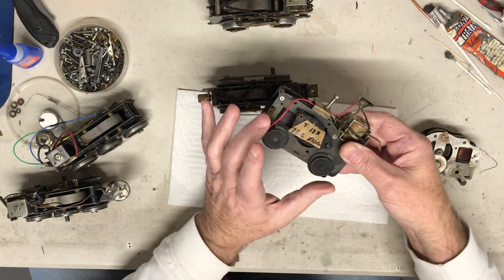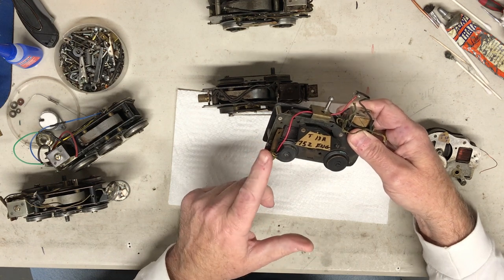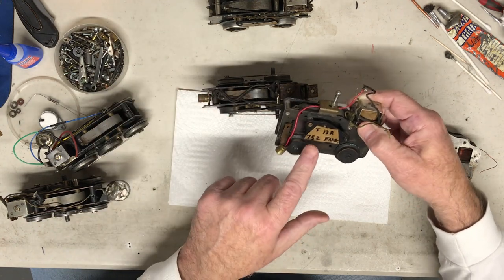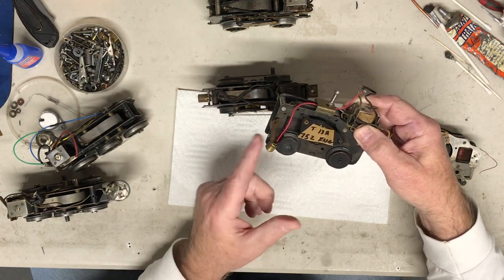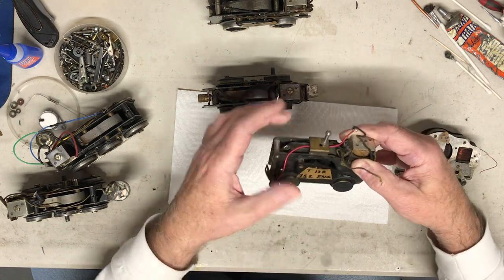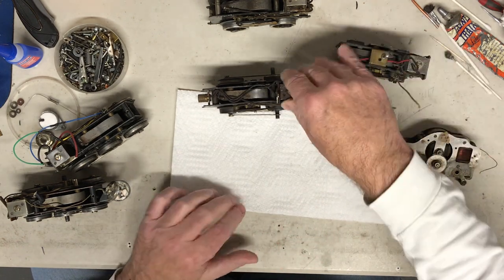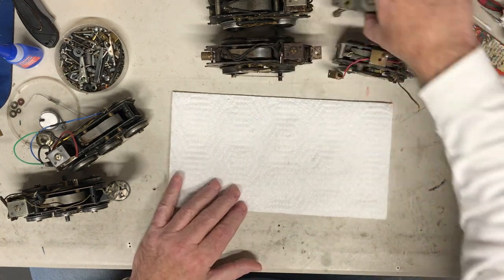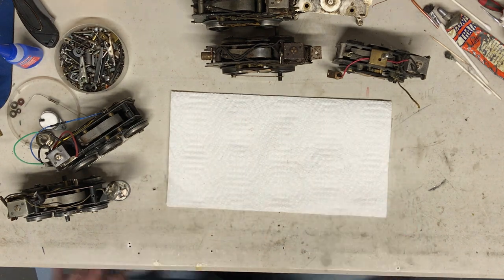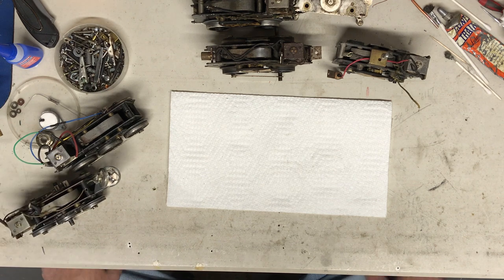And there's some other segmented trains like the 736, I believe, and the 617 or 616, excuse me, segmented Yankee Flyer. It's 3 1/2 inches in length, where this is 4 1/8. Same type of motor, same just about everything except for plates and length. So it's hard to do this. Go by, look in the book, try to find pictures. It takes a lot of time. But that's what I'll do with the motor we just repaired.